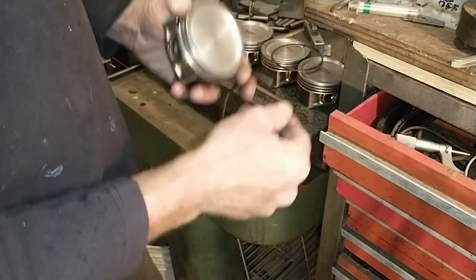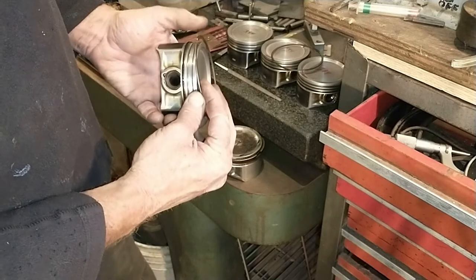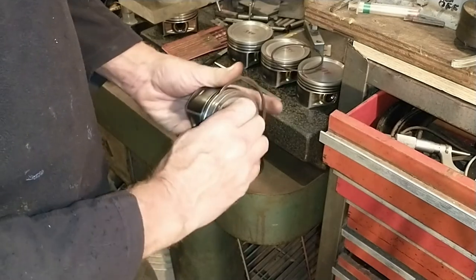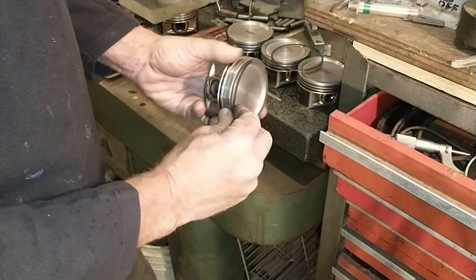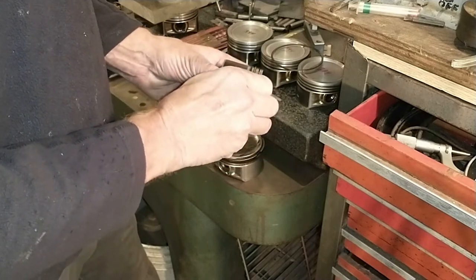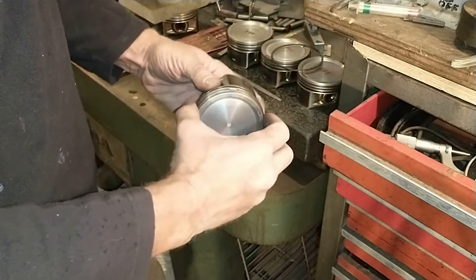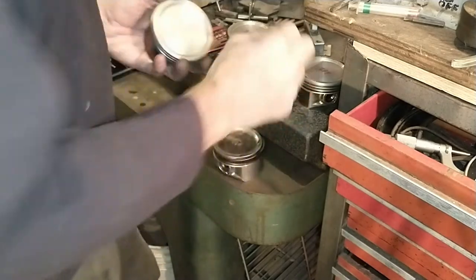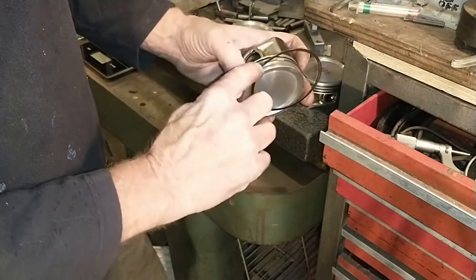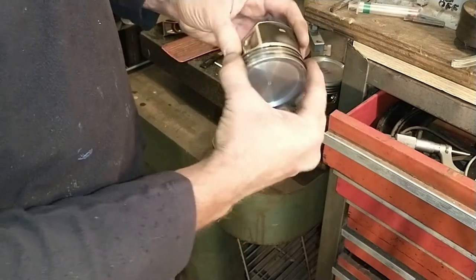Here are the tougher rings. The second ring on the bottom side has a little notch. That notch is generally for the combustion pressures to get behind the ring and provide force that helps these low-tension piston rings seal against the cylinder wall. That was the second ring — it's a thicker ring and a very brittle ring, but they're floating nicely. Now I'll get the top ring — breaking the rules — I get the tail in there, spiral it around, lift the tip of it over, and there she is in the groove. They float perfectly; this piston cleaned up ideally.